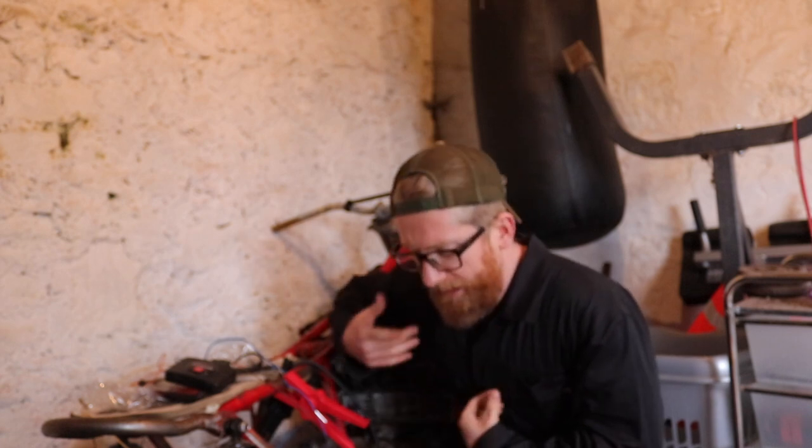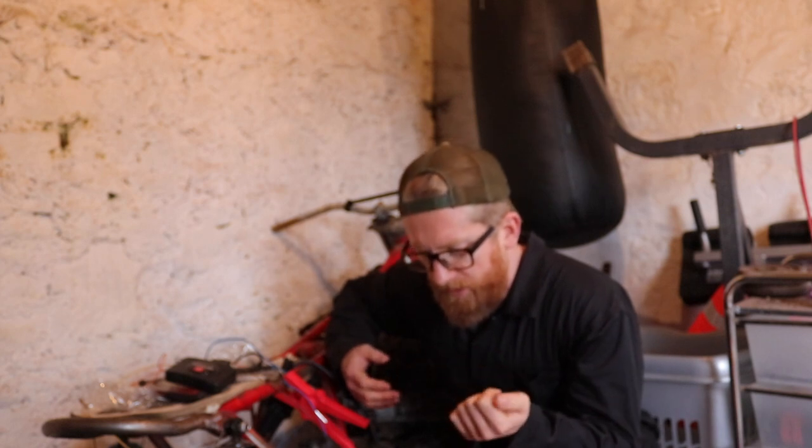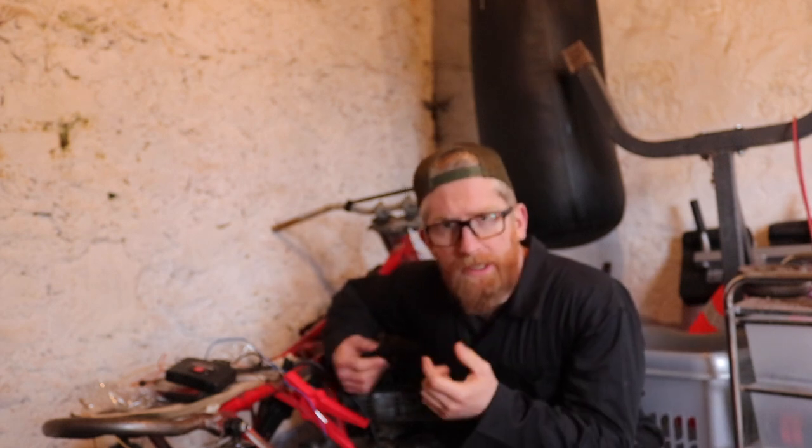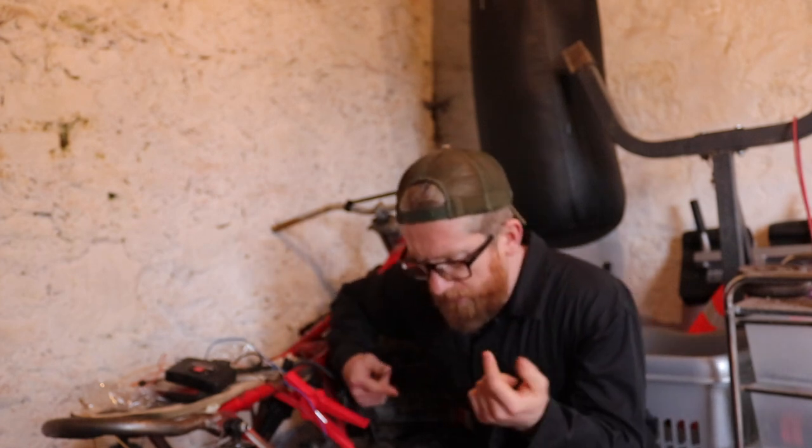And it's low, but then I ran through the motions a little bit. This bike's been sat for a while. Oil might not be getting where it needs to be, the lubrication might not be there. So I went through the process of shoving some oil down the barrels. Two out of the three cylinders improved, almost as good as factory spec, and that is cold and not been run, so we're starting to see good compression in the cylinders. Two of them were 140 and 150. One of the cylinders was 45, which is pretty bad, to be honest.